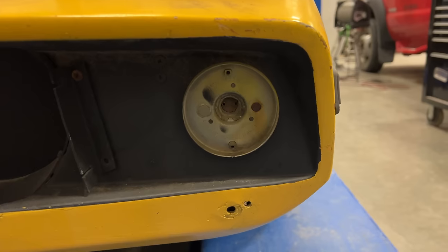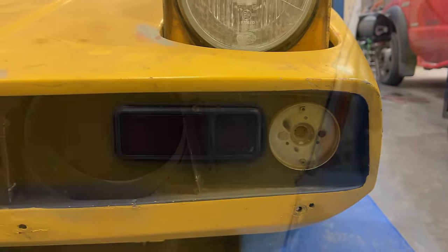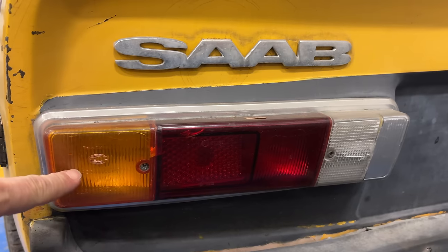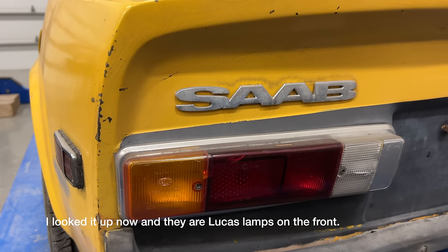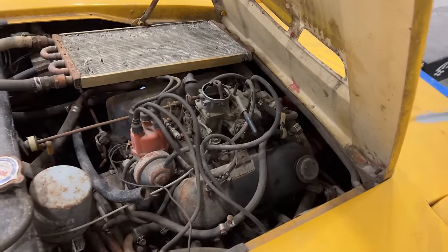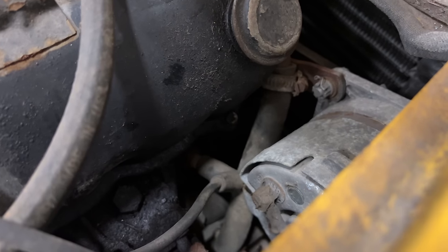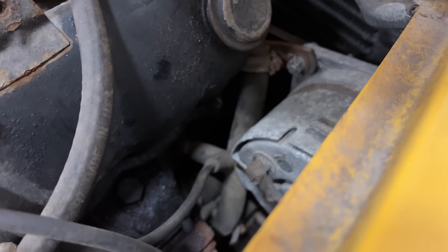I apparently don't have the lenses for the turn signals and the parking lights, so I'm going to have to come up with a set of those. The side marker lights look real familiar — these are Lucas units. The rear lighting are actually from Hella, so I'm not sure what the front turn signals are going to be, but it's possible those are Lucas and I can find them from a catalog that sells British car parts. I don't like that the air cleaners were left off this car. Looks like the spark plugs are a little bit of a pain to get to, especially that front one — getting in between the alternator and the engine, you'll be really limited on the tools you can use to get in there.